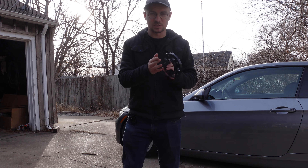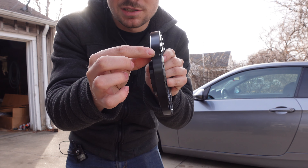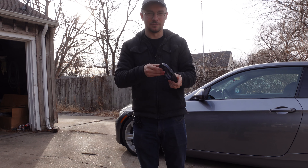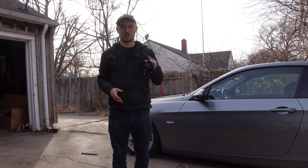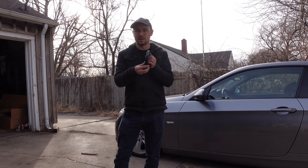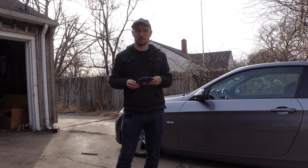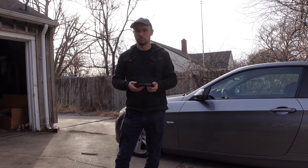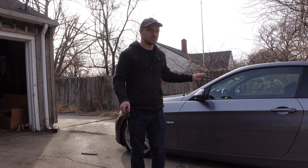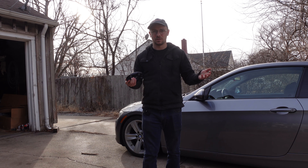The important part is this flange here, which the wheel sits on, and also a recess on the opposite side to fit onto the hub, and these notches to pry it off the wheel in case it gets stuck. This is a slip-on one that would reuse your stock studs or extended studs — but in this case, I have wheel bolts. This is a substantial chunk of aluminum that's really not going to break. What's going to happen is crappy studs or crappy wheel nuts will become your problem. They sell aluminum wheel bolts and aluminum lug nuts — never do that. BMW uses aluminum fasteners to connect accessories to the engine, but they're one-time use only because they stretch. Don't put that on your wheels.